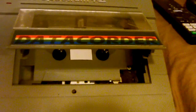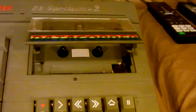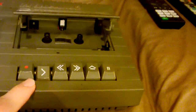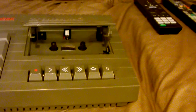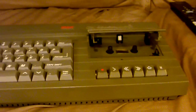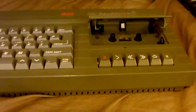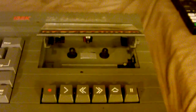The computer actually does not have software control over this cassette deck, unlike the cassette deck you can hook up to the Commodore VIC-20, 64, and 128. On those computers, the software could tell the tape deck to pause or resume playing. This one follows the original Spectrum hardware — the ZX Spectrum and ZX Spectrum 128 did not have an integrated cassette recorder; you were expected to provide that yourself, connecting only through a microphone input and headphone output. So it provides no software control over the cassette deck, and it's backwards compatible in that way.